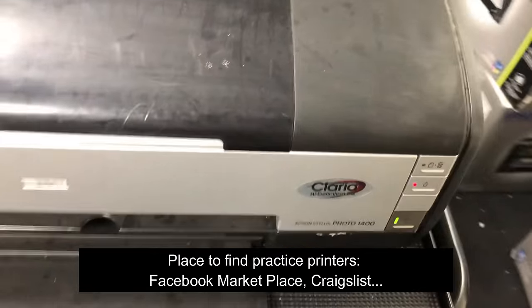We're going to fill the flushing syringe with about 3 to 4 mils of cleaning solution. Okay, here it goes back to our model again. So let's say we have some clogs here. Rather than pushing the liquid and the clog through a really tiny hole, what we'd rather do is actually suck the clog back and suck it out of the tube. And then if we have any remaining clog, we want to fill this whole chamber with cleaning solution. The cleaning solution will break this part up, or at least make it soft, so it can get sucked out again.